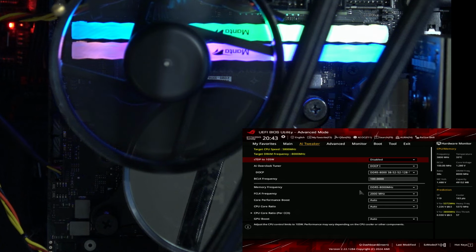So the ITX Strix is now technically the second motherboard that I've gotten working at DDR5-8000 on AM5, though the B650E Tachyon is extremely fiddly for me, and for me specifically, it only works on one BIOS. There's one BIOS where DDR5-8000 works, and it doesn't work on anything else for me on that board, which is really annoying. But yeah, hopefully this doesn't end up being a repeat of that, though with the Tomahawk I already noticed something like that happening.